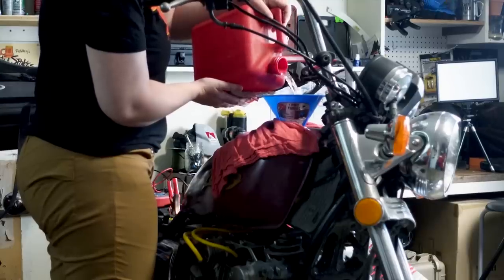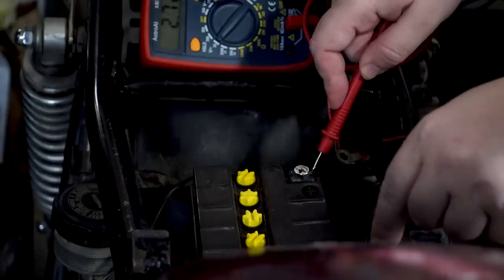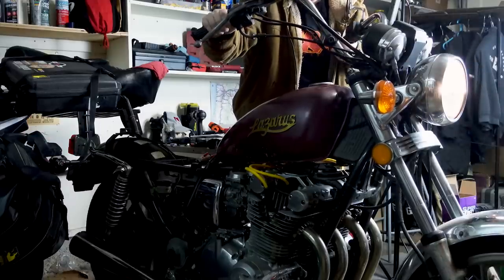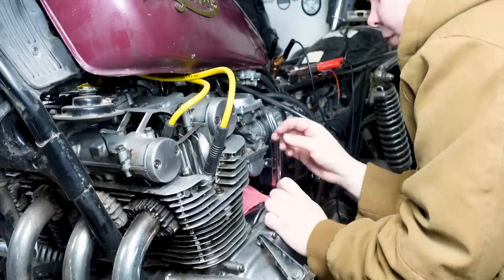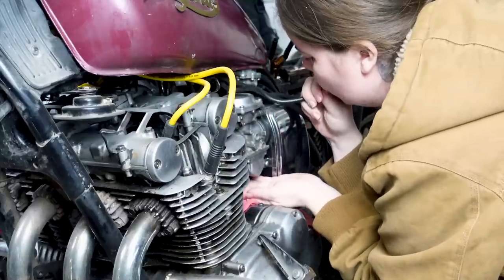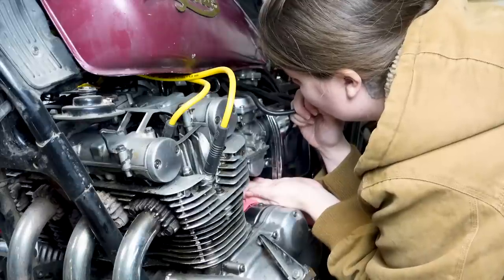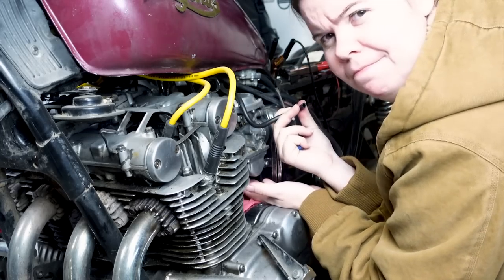So I got fresh gas, checked the old battery with a multimeter to test if it could hold a charge — and it could not. So I made a trip to the shop and bought a new battery. Our first success is we got the bike to turn over, but there was no ignition. So the next thing we need to check is to make sure fuel is even getting to the carburetors. I unscrewed the drain screws at the bottom of the float bowls of one of the carbs and put suction on the vacuum hose to see if there was any gas getting to the carb — and there was not.